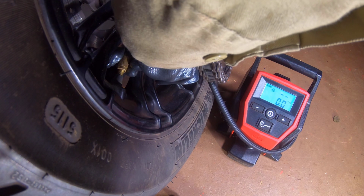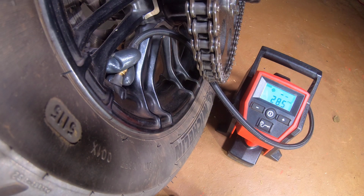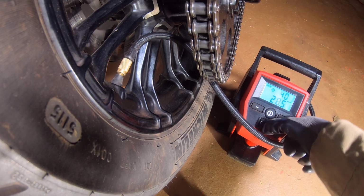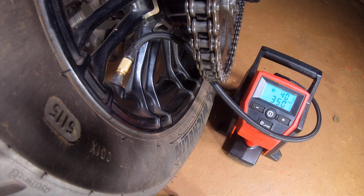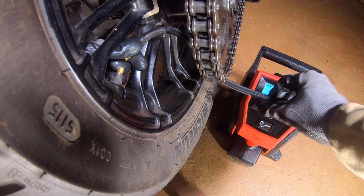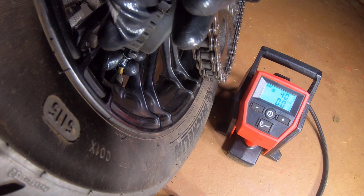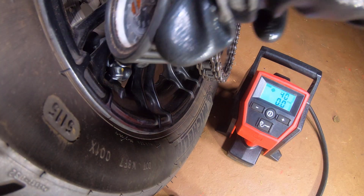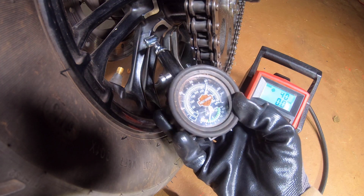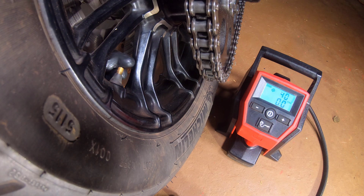The tire inflator was then attached with a hose to the valve stem of the tire. The inflator was set to the specification and the tool automatically stopped when it reached the setting. The inflator was disconnected from the valve stem of the tire and the analog gauge was again used for reference. As an additional note, because the inflator has a screw-on connection, the longer the amount of time it takes to disconnect, the more air will escape the valve stem.